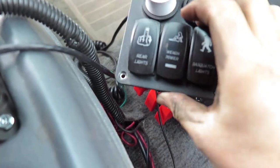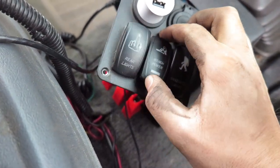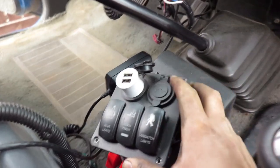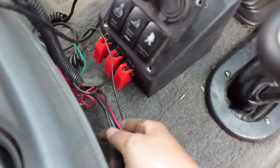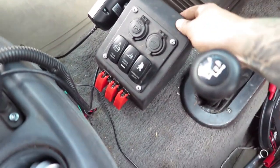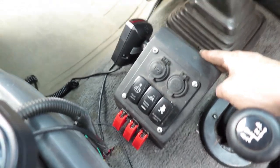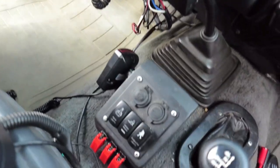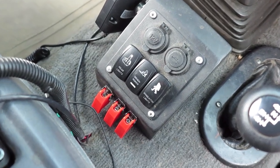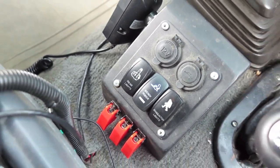So I've got some switches that I don't have hooked up to anything at the moment. I am going to use this one — winch power — which will eventually be the rear lights. Winch power is going to be the Phoenix Fusions, so I'm going to pull my wires back through and up inside this switch box here. It's all back together after messing around with wiring and different length screws and all that. We'll turn the key to accessory — the button I chose was winch power — that's on now.